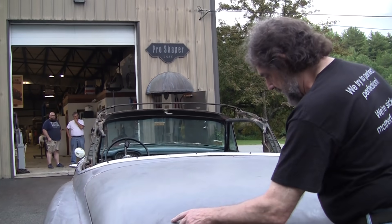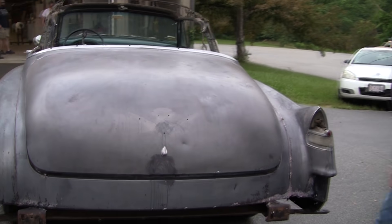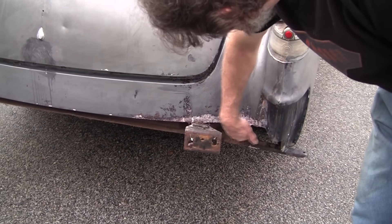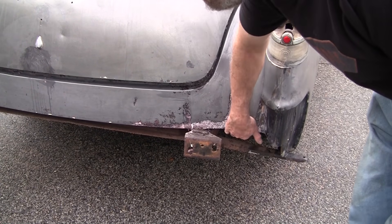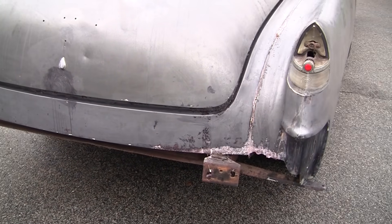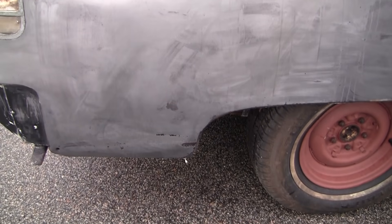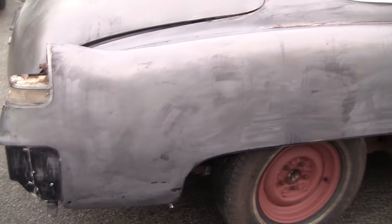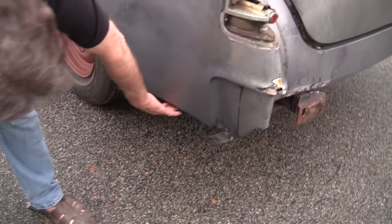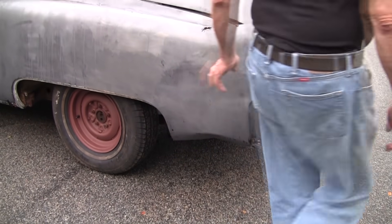There were a lot of little parking lot dings on the trunk. We'll have to straighten those out — some of them are blind because the inner structure is there, so we'll have to show a way to fix those. The back pan right here attaches to a lip right here, and on this fender head the lip has rotted away. The other side is fine, so we'll copy the information from the other side and reproduce it. This fender has a dent right here and also one here. On the other rear fender, it looks like somebody jacked it up and put a jack stand under here and crunched it in — a real minor fix. The stainless molding got crunched up, and all those will be covered in videos.